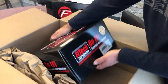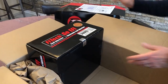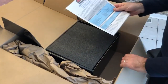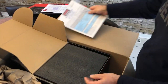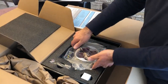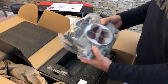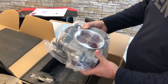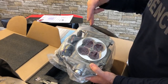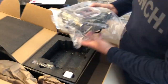The oxygen sensor lets the system know whether the vehicle is running rich or lean, and then it can adjust the fuel ratio. From what I've read, that takes a couple of weeks for the system to fully calibrate, but it will run right out of the box. We have the instruction manual, and here's the throttle body unit — it looks very similar to a carburetor. What's neat about the FiTech compared to some competitors is that the ECU that runs this is actually built into the throttle body itself. So you don't have a separate box mounted on your firewall with cables running all over the place, which adds a lot of simplicity.